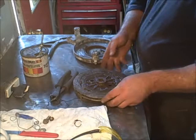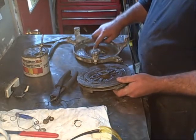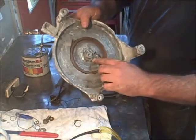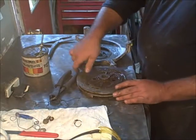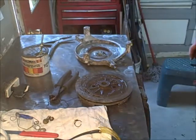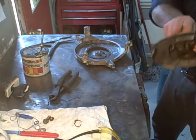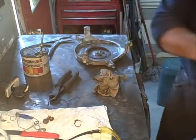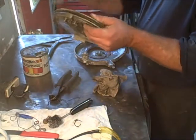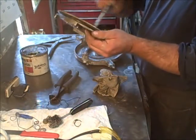Get that in there. Now you can see there's a pin right here on the back of this — I'm gonna wipe this off a little bit — but that pin goes right in there. Then you see there's these slots; they line up with these two slots here. There's a slot there and a slot there — I got grease on them but you can hopefully see it. They line up with those, and then you gotta line that pin up into that hole on the spring. Let me wipe this thing off a little bit — it's in better shape than the one I'm replacing, but not by a lot. A little grease on that too.